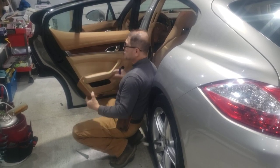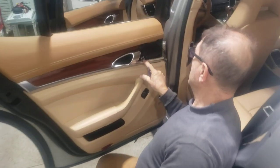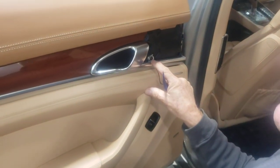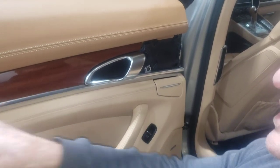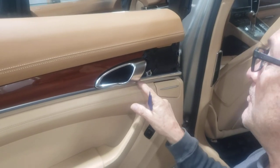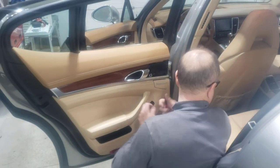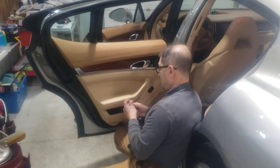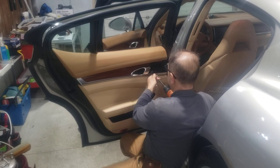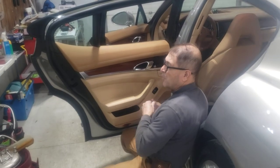There's really just one little screw hidden behind this cap. So when you remove this cap, this little screw over here needs to come out so that when you remove this molding, you don't bend it. And this is a T15 — it's the only T15 on this door panel. Everything else is T30.